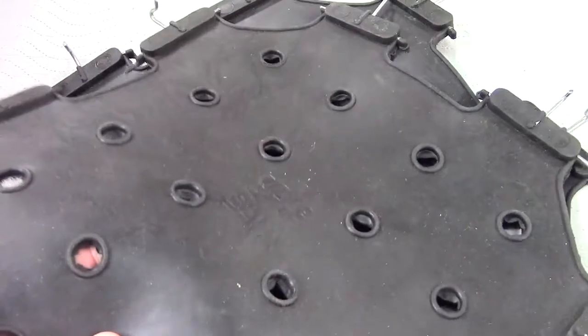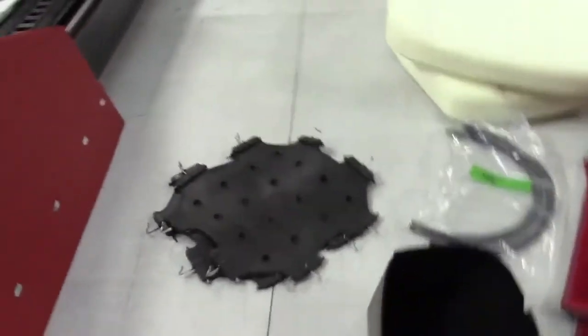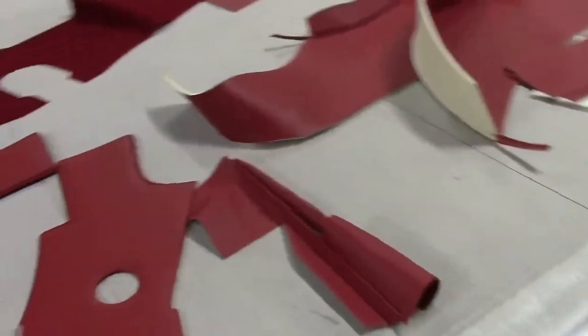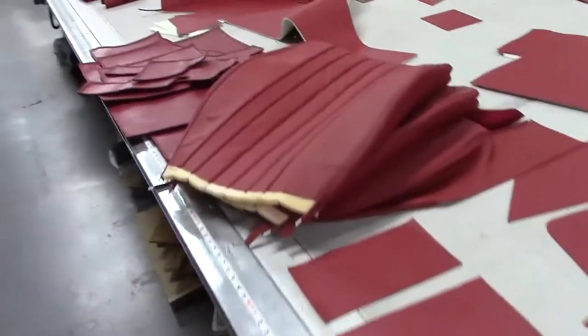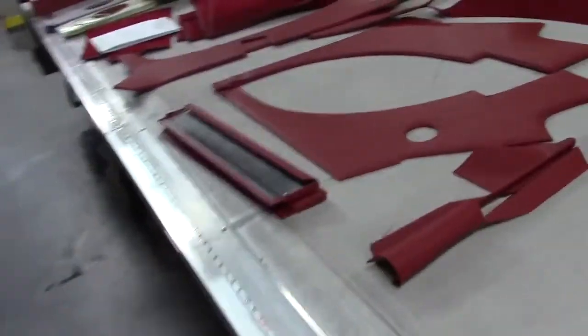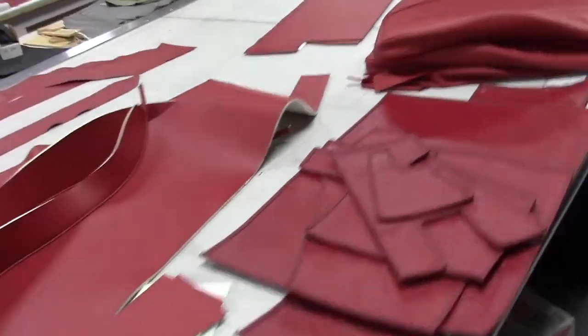You can see our seat diaphragms — 4.2 — they come with the brass inserts and hooks installed. It's essential that the seats are rebuilt with the seat diaphragms. We offer labor services where you can send us your seat frames — you can see the condition we typically receive them in. We completely refurbish them, or you can prepare them yourself. The seat frames need to be painted and cleaned — we don't rebuild over poor quality seat frames. We replace the lumbar support, tack strips, and other things as necessary.